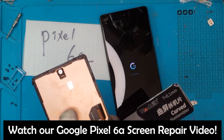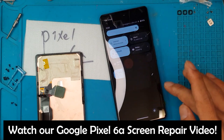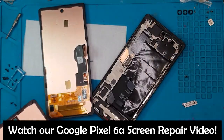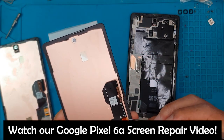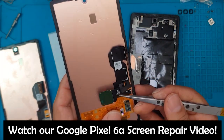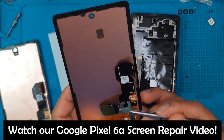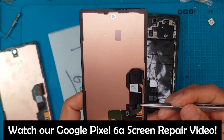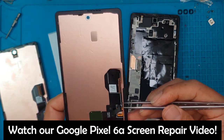While he's booting up the smartphone, he's removing the fingerprint scanner from the old display. The fingerprint scanner for the Google Pixel 6a is located behind the display. We're going to remove the sensor and transplant it to the replacement display. The connector is right here, and the trick is to precisely position it to the cutout so that the smartphone can register the fingerprint. The replacement screen doesn't come with this part, as it's a separate component factored into the pricing.